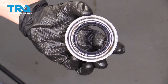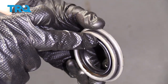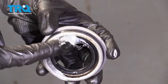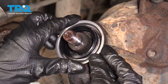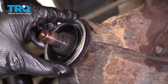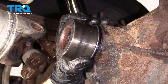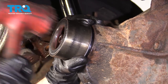Now it's time to prepare our seal for installation. Take a look along this edge — you want to make sure that the seal is going all the way around it, and on the inside right along here you're going to have a little spring that goes along this rubber. We need to take a little bit of petroleum jelly and go right along that spring area — that's going to help keep the spring in during installation. Line that up as flat as possible, parallel to the edge of the differential. Take something that fits over the outer lip — we don't want to press in on where the rubber is. I've got an extra bearing I'll use with my rubber mallet, and we'll give it a couple loving bonks along all four corners and drive it in.